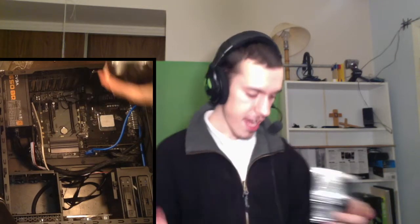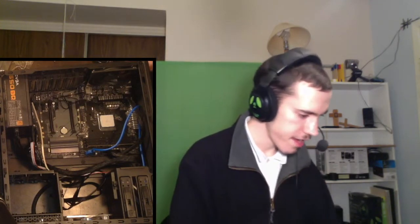This is the cooler — it's got the fins, the fan, and the power plug on the other side. You can see it has this piece where the AMD symbol sticks out, which has to go on the other side away from the memory ports — that is why we're turning it around. So it goes on like that, but before putting it on, let's take a look underneath, and everything should be secured for tilting this up because the motherboard is now screwed into place.